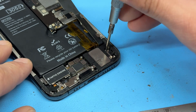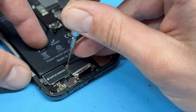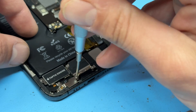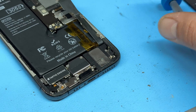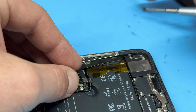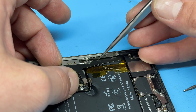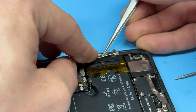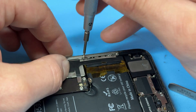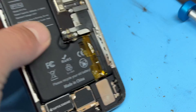As well as the other standoff screw just here, one crosshead screw in the very bottom right and another one just above it. The last part of this bottom assembly is the little shield that goes on top, secured down with the four tri-wing screws. With all that re-secured, realign the port. It looks like it's a bit more difficult than anticipated, so I'll remove these two tri-wing screws, lift up this shield, place that on top, and re-secure this little shield back down with the two tri-wing screws.